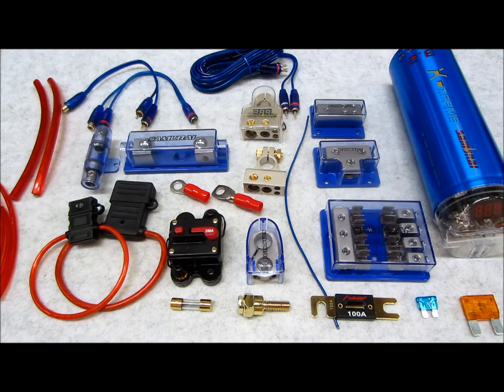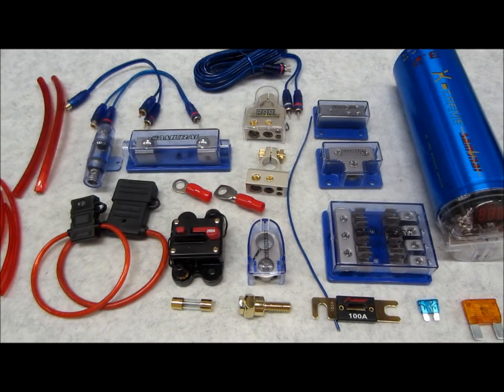See forums, other people who've used similar equipment, because there is no one right answer for every job. Now, a couple words on grounding. Like I mentioned, some vehicles require a good common grounding point. Some vehicles benefit when you have separate isolated grounding points. Sometimes you have that with a combination of a common ground from front to rear. I've seen it all. There is no right answer, like I mentioned.